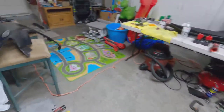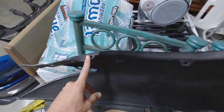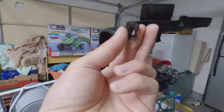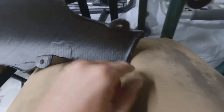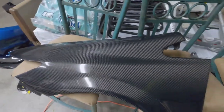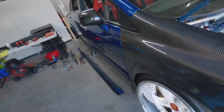Before I do anything about putting it on, I need to cut this inner fender liner. I have to cut through here all the way down so I can roll the fender lip. I'll probably cut this little bracket off because on my OEM ones they were all snagged up from dragging on the floor. I'll sand down just a tad bit around this headlight, not much. This pillar fitment is a lot better than the other one. Before I put this one on I'm going to sand down those pieces and then cut the fender liner since I already know what I did on the other side.